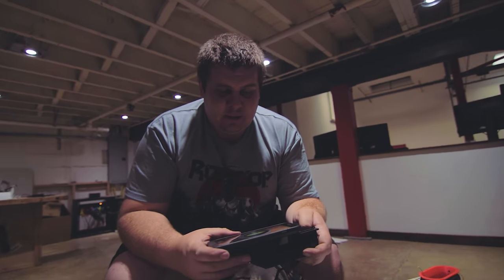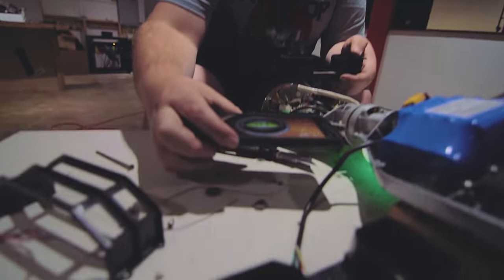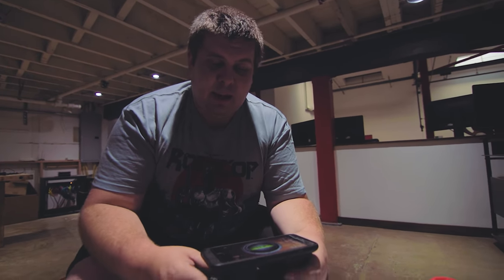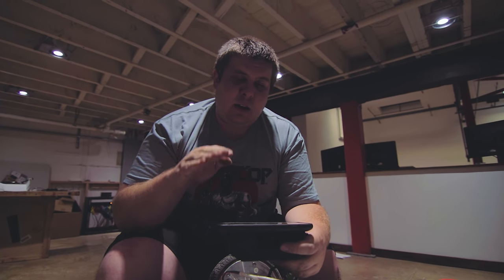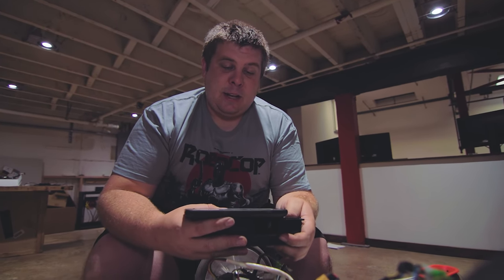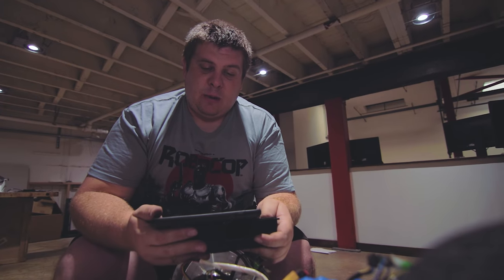I just took off these things and powered everything back on. What I'm doing is I'm using my IMU inside my phone as a leveling system. Here I can get how level something is and it gives me a readout of how many degrees it goes. This case should be leveled, so if I set this on top of the case and I hold it level, that should mean your feet are level on the hoverboard. But it's saying speed exceeding — I have to hold it at about four degrees off. I think that has to do with why you can't turn as fast one way or the other.